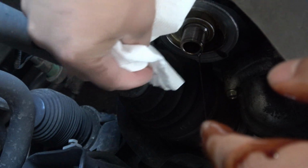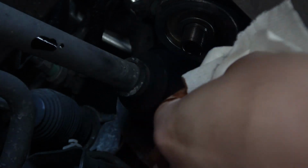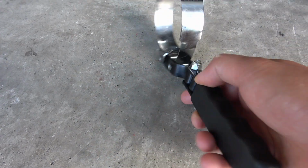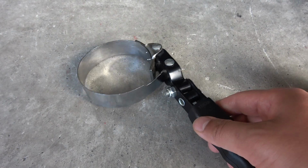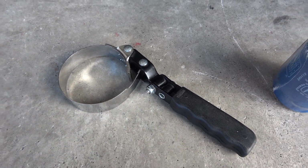And I usually just like to clean the mating surface where the new gasket for the new oil filter O-ring is going to sit against. Just like to wipe it down. If you guys have issues getting enough leverage to loosen up that oil filter, you can always just buy an oil filter wrench like this, and that'll give you additional leverage to clamp down and loosen and tighten. I'll have a link in the description down below as well for that.